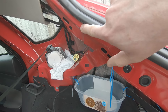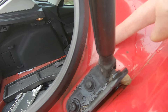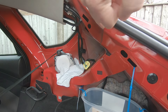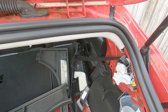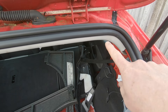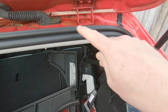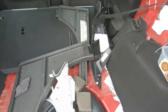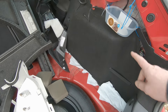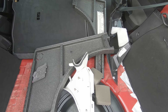The last place mine was leaking was through the boot seal itself. On the back side here it had shrunk and pulled away from the bodywork — water coming down was hitting the side, rushing up underneath it, and I caught a drip running down and sneaking between the two panels. I lifted up the seal and found that from the factory there's a gray non-setting putty underneath it. I got some plumber's mate — a non-setting putty from any DIY store — rolled a little bit around it and shoved it back on. It's been absolutely chucking it down on and off for the past few weeks and months, and the boot is now completely dry. Hope this video helps you solve your leaks as well.